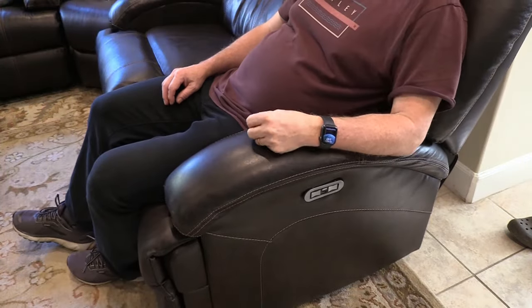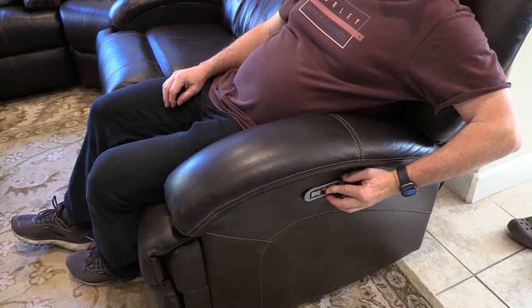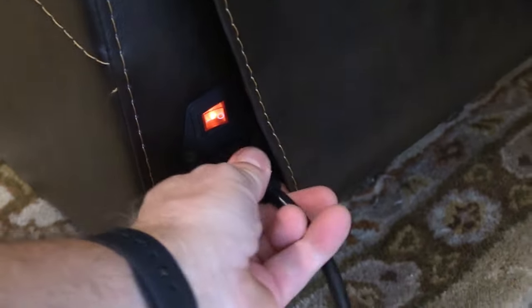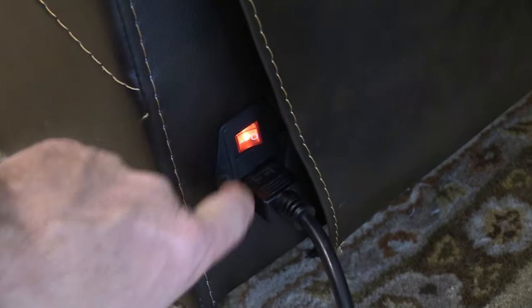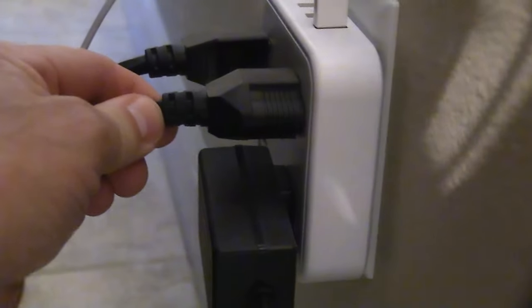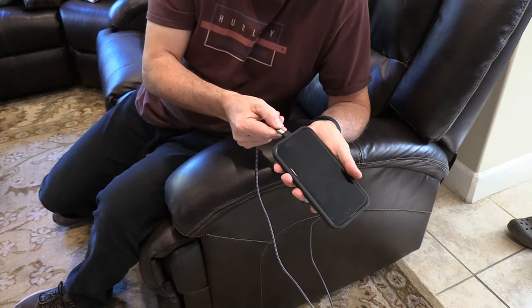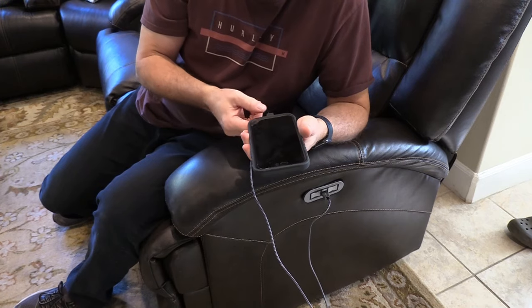Okay, let's get started. As I mentioned, after I sat down and found out the chair wasn't working, I started with a little troubleshooting. As you should always do, first go right to the power source. First, is it plugged in? Is it secure? Toggle the switch back and forth to make sure that it didn't accidentally get turned off. If the red light is illuminated, then you're getting power. If there's no red light and you've checked to make sure everything's secure here, check also at the wall. Next, plug a device into the USB switch on your sofa. If the device doesn't get power, this tends to support the theory that the switch is your underlying problem.